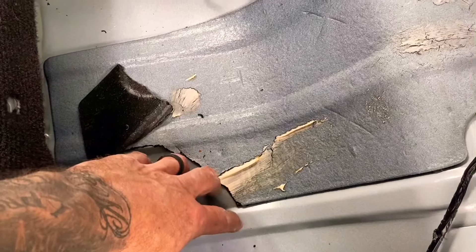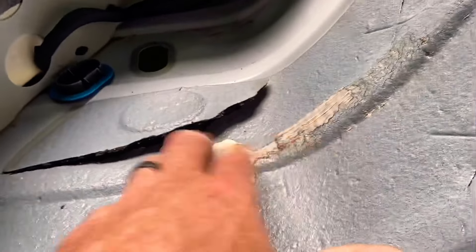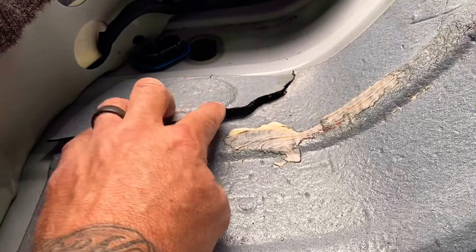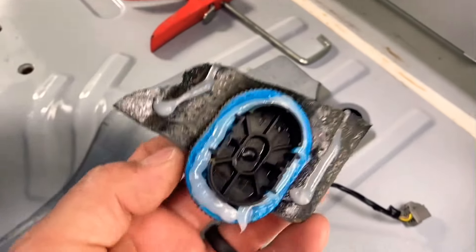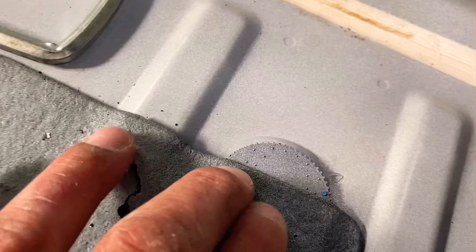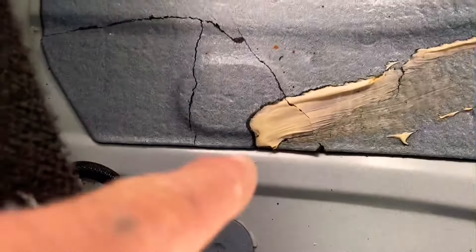I think this area has been filled with water causing everything to get wet and stay moist. I popped this one up as well — this dampening material is just like Dynamat, to keep the noise down. That one was soaking wet too even though it was sealed, so I'll silicone it back down. I'm just putting a bead of silicone on the old gasket, a little here and there, then sticking it right back in the hole. Silicone squirts out — let it dry and it's sealed.